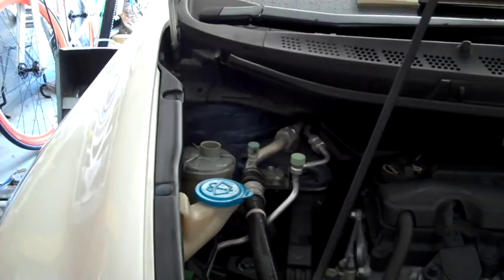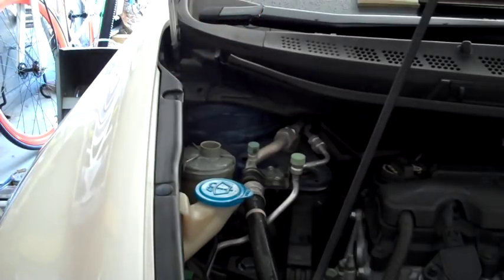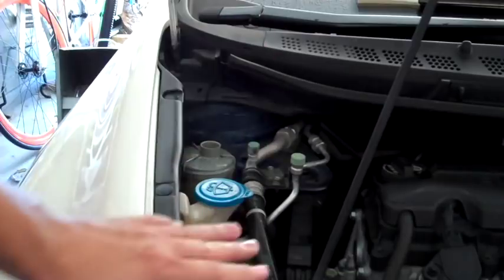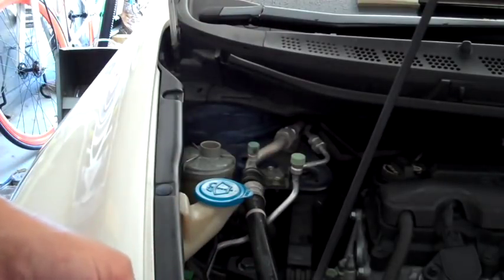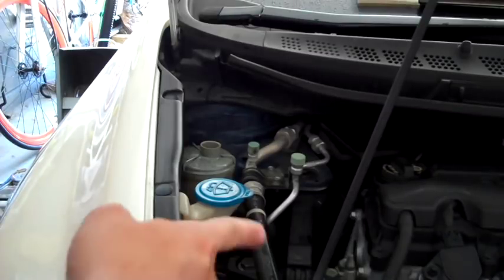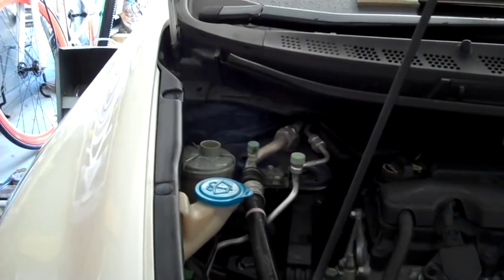At this point I'm going to put the car up on the jack, put it on a jack stand, get the wheel off, and see if I can gain access to the power steering pump. Another thing you want to do is remove the serpentine belt before you jack the car up — it's a lot easier to do when it's on the ground. I've got another video on how to do that using regular tools without buying the special tool. The tool is only $15 but it doesn't come with a 19mm wrench, which is what you need.